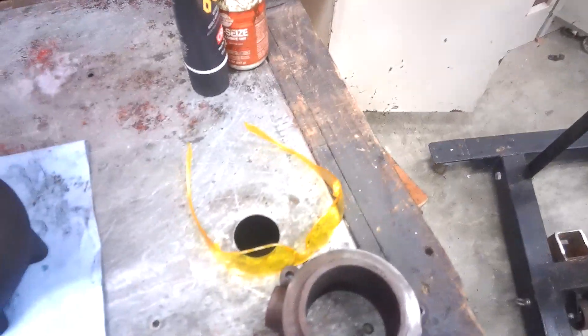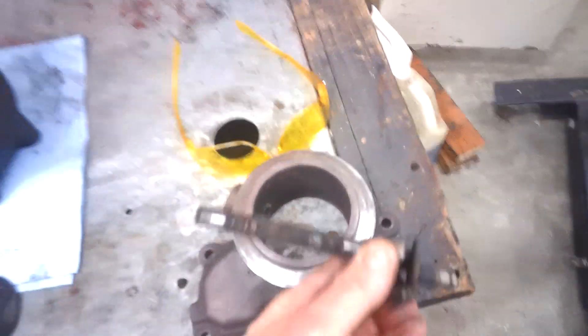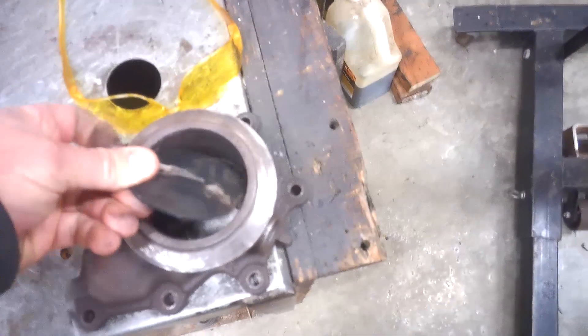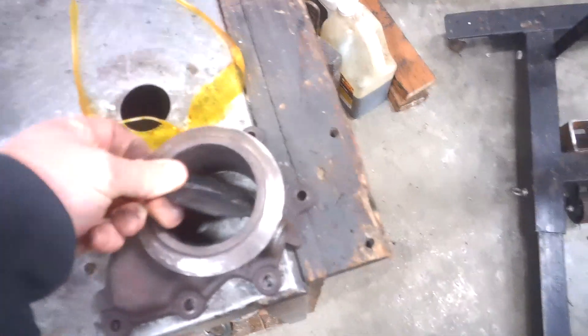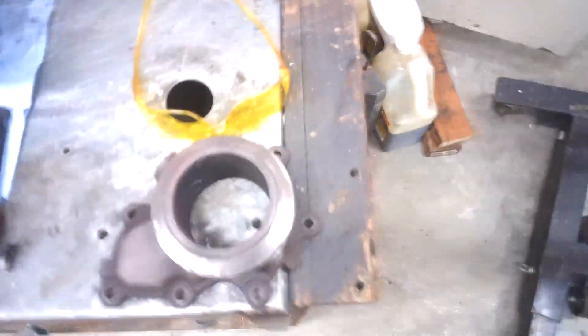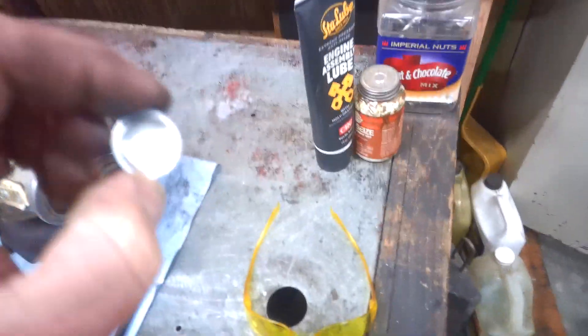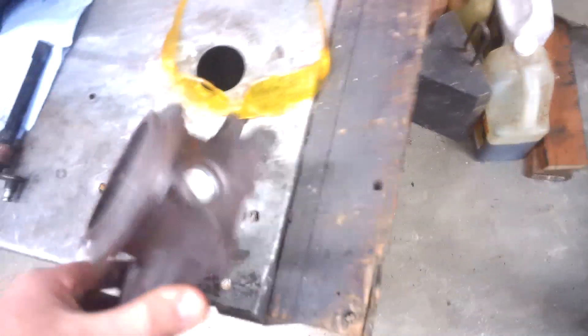This plate is just riveted on, so you can just grind the rivets off. It's got a snap ring on the end of it — take the snap ring off and slide it out. Basically what that does is it allows the exhaust to get out without this being in the way, because even with it wide open it doesn't open all the way — it's still partially closed, which disrupts the exhaust flow going into the turbo. Once you get that all out of there, take a three-quarter inch freeze plug. Since this side's already sealed off from the factory, take the other side and press the freeze plug in there, install the snap ring — voila! Now you have a free-flowing exhaust.